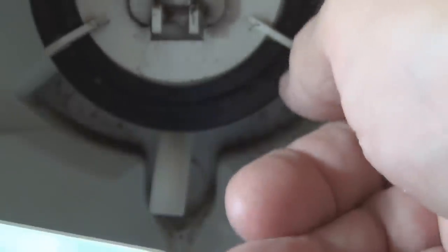So you can see accumulation of dirt. So right here, I don't know, there really doesn't look like there's much of an opening. This is the door, a little rubber door that should be secure. But that would also let some cold air down onto this tube here if it doesn't close sufficiently. So it could be even just a matter of cleaning any grime that doesn't allow this rubber to seat properly, allowing some air to slowly leak. So that could help too. I'm going to clean that.